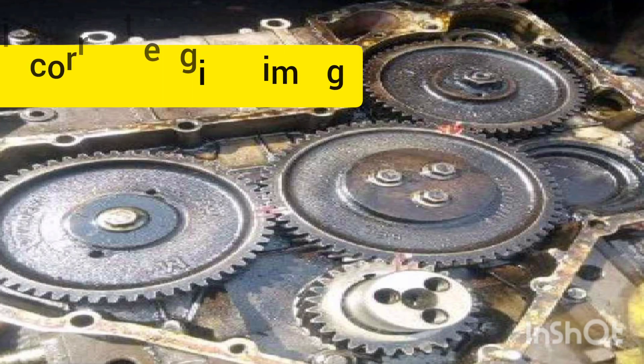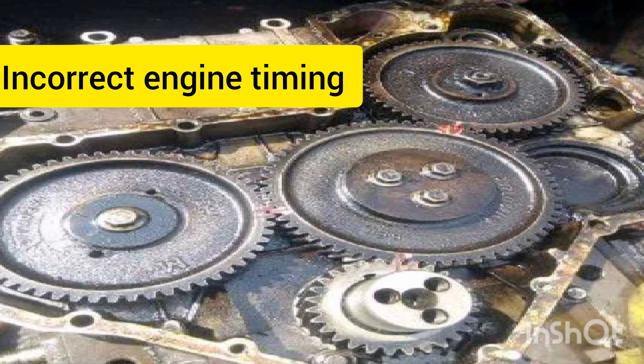Number three is incorrect engine timing. When the engine timing is not correct, in some cases the crankshaft may not rotate. Don't be surprised — it has happened to me many times. When you turn an engine and the timing is not correct, the crankshaft will rotate to a point and then stop. If you turn it in the opposite direction, it also rotates to a point and stops. That tells you the timing is incorrect, but with wrong timing it will not be a seizure — the engine can rotate a bit in both directions before stopping.